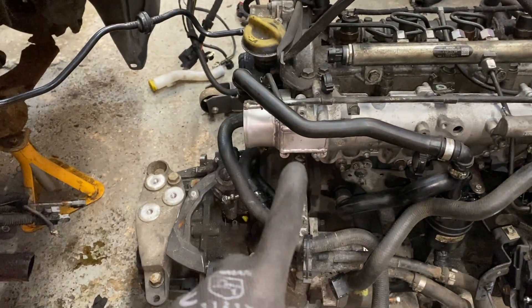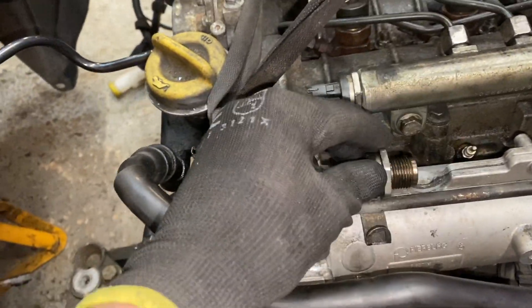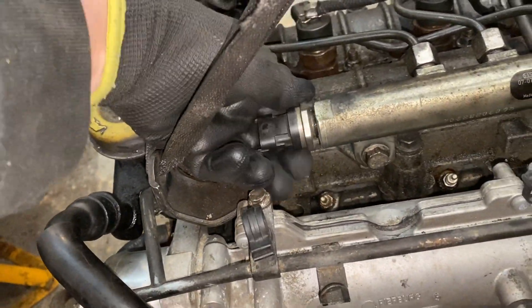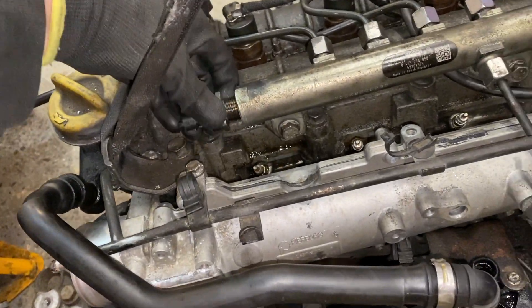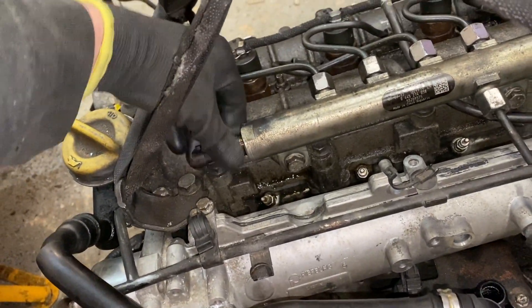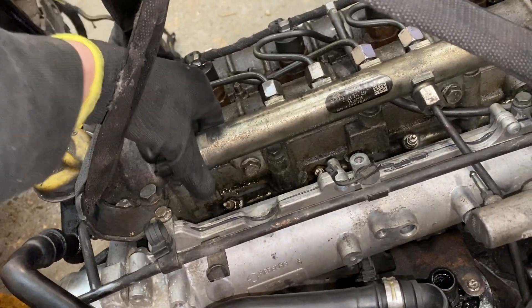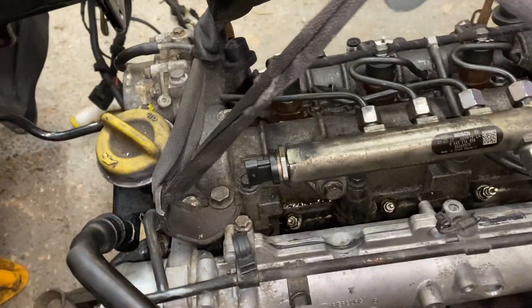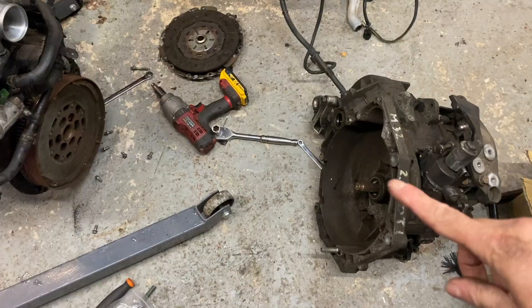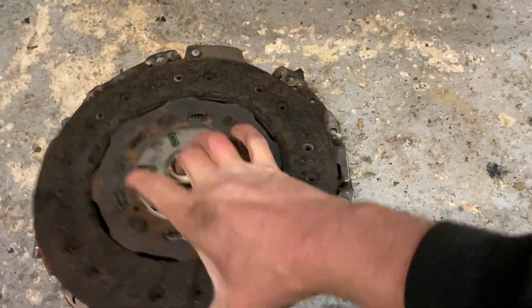Pump's on, modified inlet's on — as you can see, no shutter valve, no EGR, quite simple. The 2200-bar rail sensor: second-hand one, just wind this one out and put the other one in, as simple as that. You need these modifications to make over 250 to 260 horsepower depending on turbo specs. We're going for around the 300 horsepower mark so we're going to need all of this.